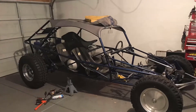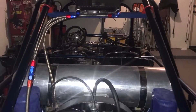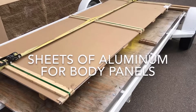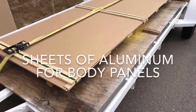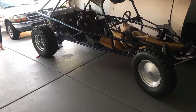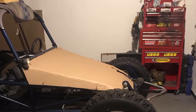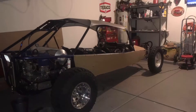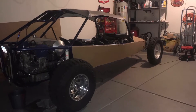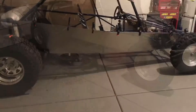Here we're getting ready to put the side panels and hood body panels together. There's our AN fitting lines and our aluminum sheet metal for the body build. We fit a template for the hood to see what it looks like, zip-tied it in place, then zip-tied cardboard for the sides to get a template so we don't waste the aluminum. Now we're going to hammer it into shape.